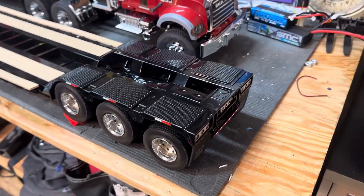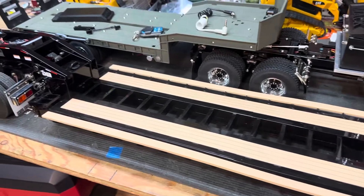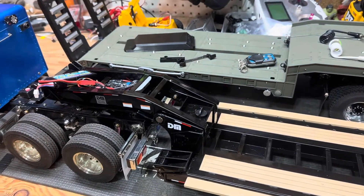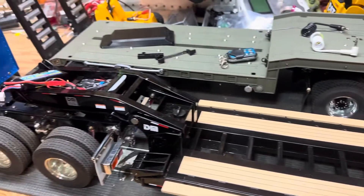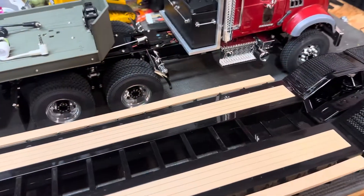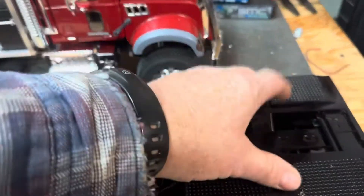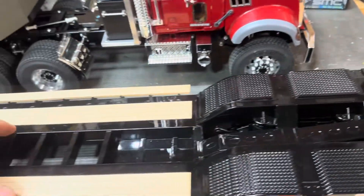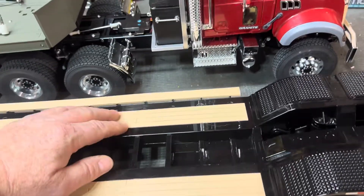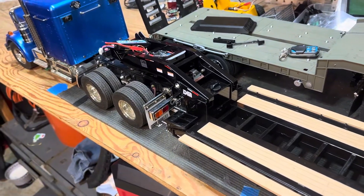Those are the LEDs I use. They come with their load resistors already wired up and they've got a huge voltage range — I think 5 to 12 or 5 to 14 volts — more than enough range for what I'm doing with my trailers. I haven't taken it to that step yet, but if I ever did, there are 4 conductors running all the way back. All I'd do is take 2 for the high, 2 for the return, and take them directly back. It might be a project for another time.